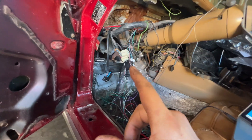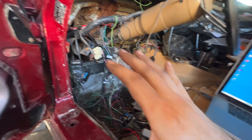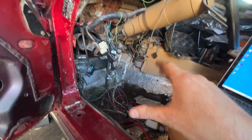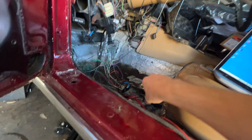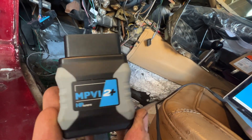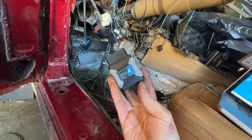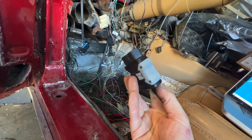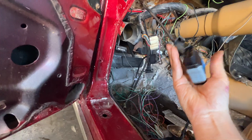I'm very excited, I'm a little bit nervous. But the very first thing I have to do here is unlock the car's computer. This being an LS model GM ECU, it has the VATS security system on it. But there is a way to delete this, and this should be the key here — HP Tuners. I've never done this before, but this is an OBD2 computer reflasher, editor, whatever. So I should be able to plug this in.